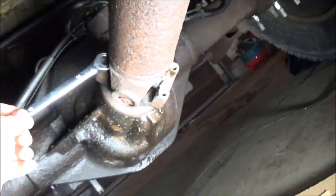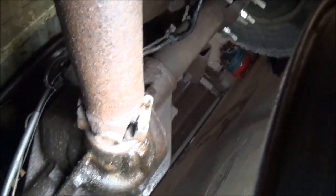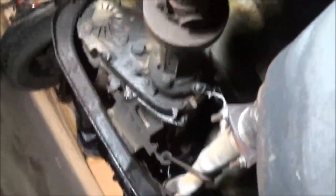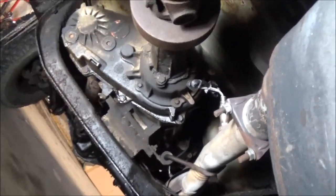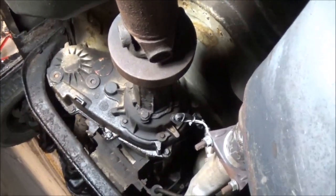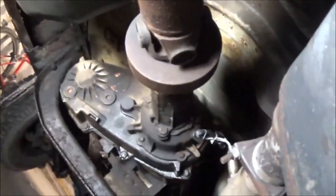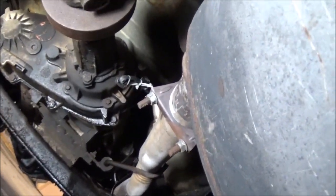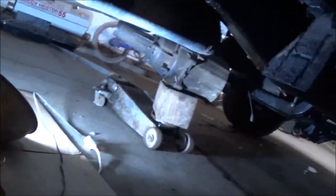So instead of sitting around grumbling and complaining, I'm getting right to it and taking this drive shaft off so I can slip it out of there. I already got the skid plate off that is right directly under it. Then I've got to pop the four bolts off on the front drive shaft companion flange, and I think there's like six bolts that hold the transfer case to the transmission. All right, I got the transfer case out.